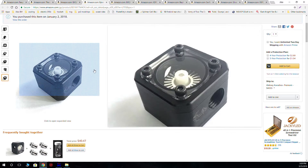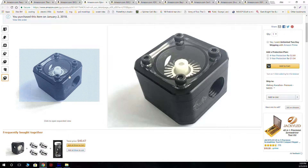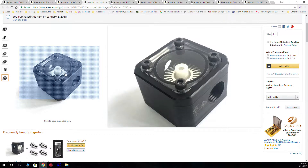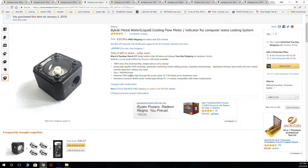The next thing that I got was a flow meter. These are pretty important because you want to make sure that if your pump ever fails, you're aware of it right away. These are really obvious because they give you a visual indicator that the pump is spinning — unless you get one of those fancy new pumps that have a USB out that lets you monitor what's going on, or unless you have a pre-built solution. This is pretty much a must-have. You want to get something that's easily seen in your case — if you have a side clear panel, make sure the flow meter is somewhere obvious so you know your pump is actually circulating the liquid.